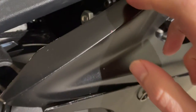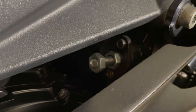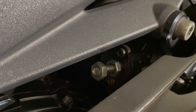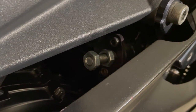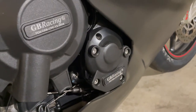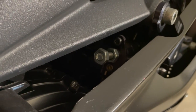A little closer, you can see the APE cam chain tensioner — that's a manually adjustable one. The automatic hydraulic tensioners tend to fail on these bikes, as mine was beginning to when I purchased it. If you let the bike sit for more than a day, the oil would drain out and on a cold start you could hear the chain ticking and slapping against the guides. Easy fix, great part, highly recommend. Installation is pretty straightforward — remove the timing cover, use a socket to keep tension on the chain while swapping the tensioner, then set the slack per the instructions.